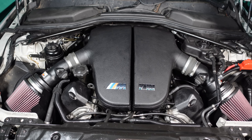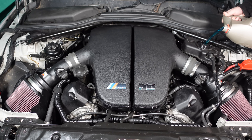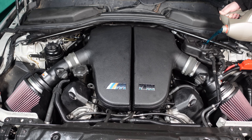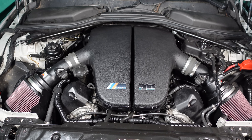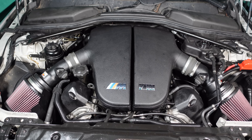We're going to go ahead and start pouring it in — let's hope there's no leaks. This will be very empty as I've drained it from the whole engine, the water pump, and the radiator, so we're re-topping it all up. By the way, this is ready mix so I don't need to add water. You can see it's taken a whole five-liter bottle — it's completely empty. Now I'm going to turn the ignition on and put the heaters on low.